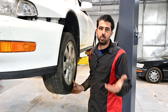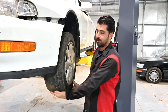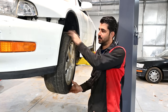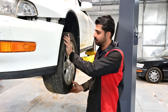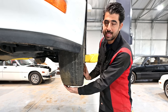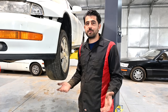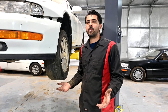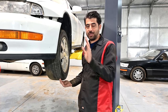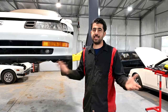So with that out of the way, the next question is: what do you want? With zero degrees of camber, where the wheel is exactly perpendicular to the ground, generally speaking, you have the greatest amount of contact surface between your tire and the road when going in a straight line. Zero degrees or neutral camber is likely to give you the most even tire wear in a straight line, but it's not really good for traction and handling around corners — and that's due to body roll.